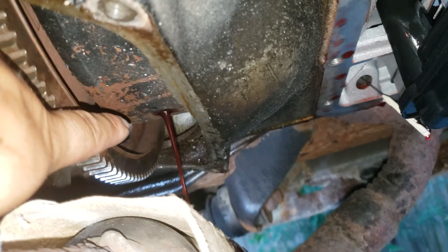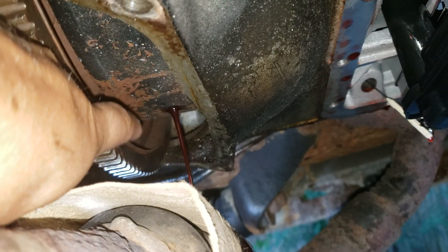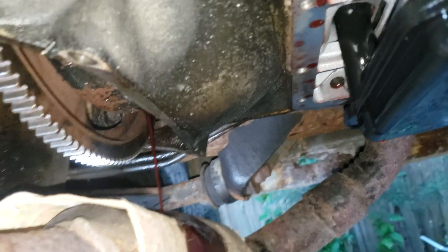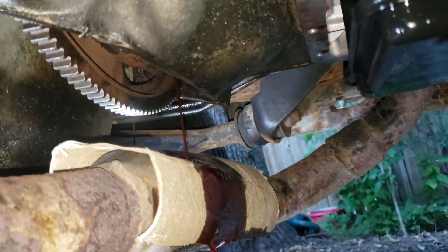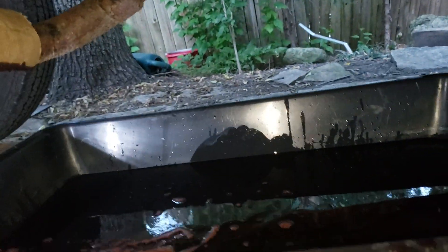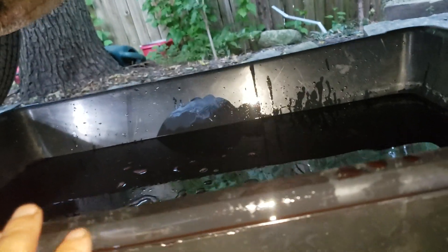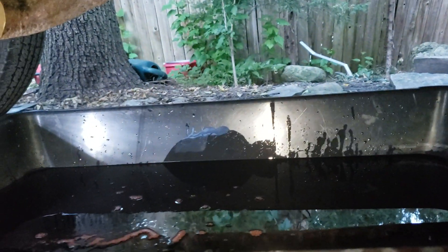Like I did right here — and you can see now it's almost straight down, so I'm draining it. It's been draining for about 4 minutes now and I think another 4 quarts came out. I think this is a 5 or 10 gallon pan, and it's already close to three-quarters full — so you're talking about 15 quarts of transmission fluid.